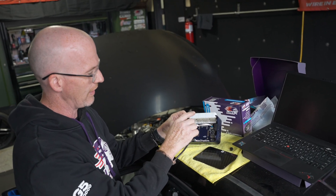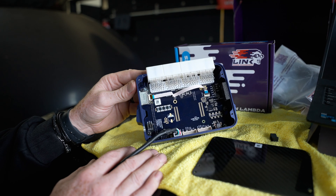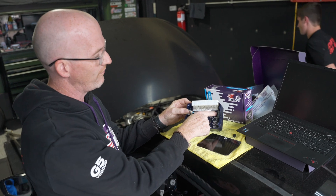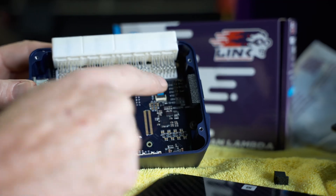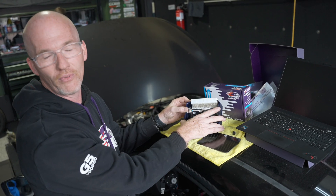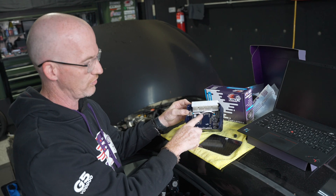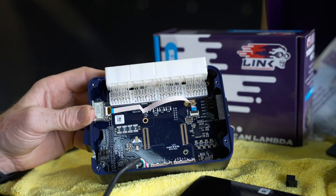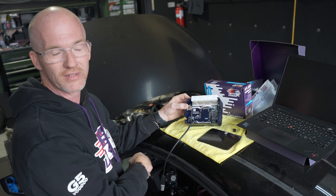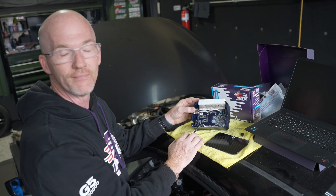What's really cool is this ECU can control both direct injection and port injection. Hypothetically, if you want to swap to a 2JZ or an LS, you can repopulate the jumpers to control up to eight outputs — so this ECU will work with any conceivable engine swap. It also streams the CAN bus to the dash, so whether you're running a stock engine or an aftermarket engine, everything is still displayed through your factory dash. Super clean and tidy.